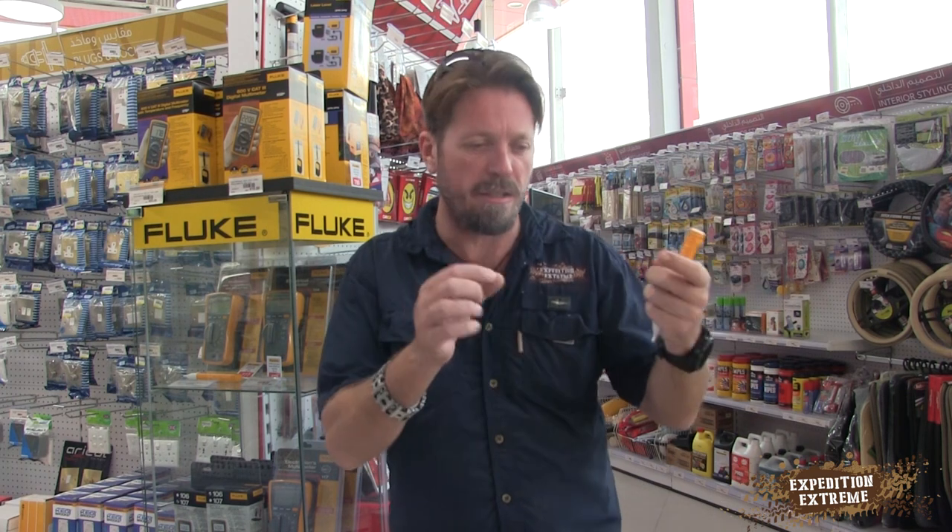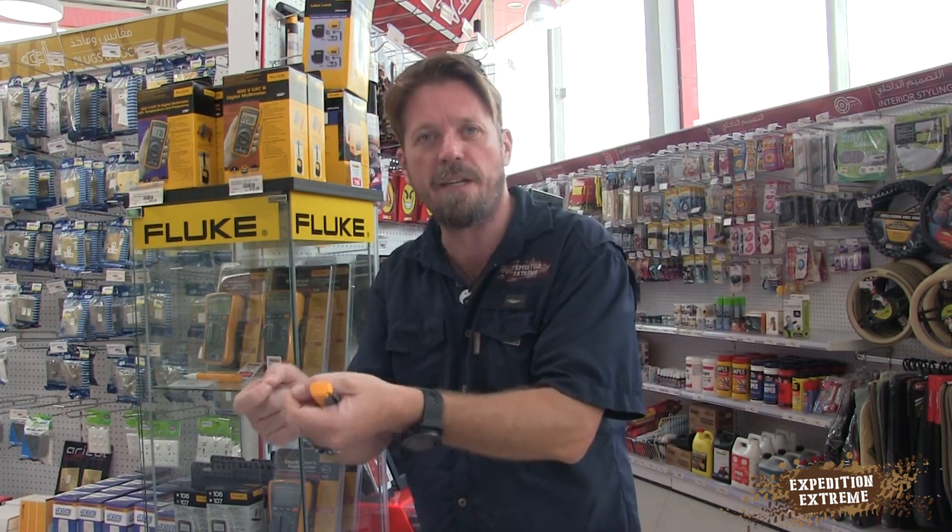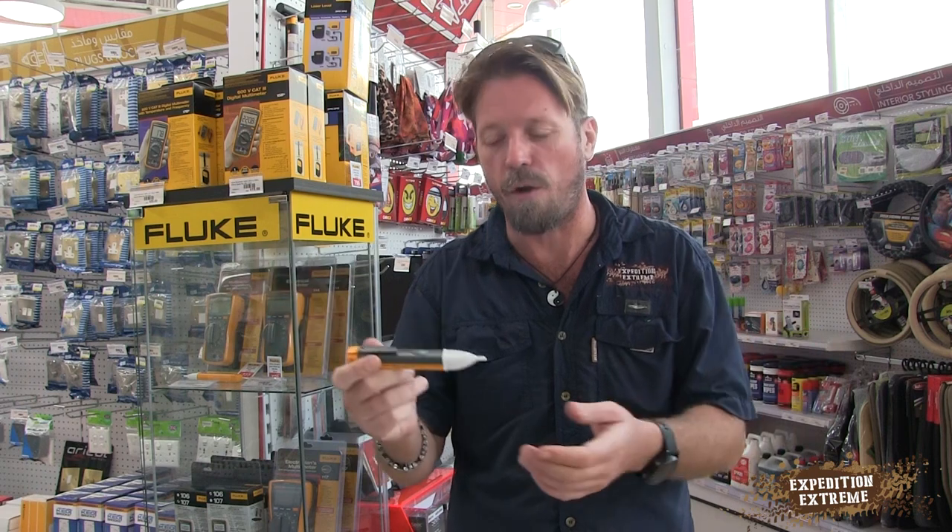To detect issues properly, test your battery — say you're getting 12 or 12.8 volts — then test the connection going into the fridge and you'll see the voltage drop. You don't have to be an electrician: red goes to red, black goes to black, and it'll tell you 12.5, 11.5, whatever the case may be. Absolute must-have in your vehicle. Catch you next week — remember, if it's dusty, drive it!